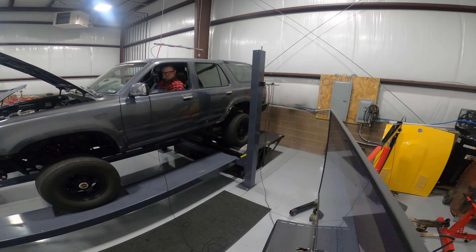We still made 678 to the tire on 39 — or 38 pounds, I believe. Call it a night — she's dialed in, air-fuel ratios are almost spot on with what we're commanding, injector duty cycle 50%. That mechanical pump is putting in work. There you have it: the Toyota 4Runner, 1J head, 2J bottom end, Garrett small-frame turbo, at 38 psi making 680 to the tire. These are the two dyno graphs — where we started and where we ended up.